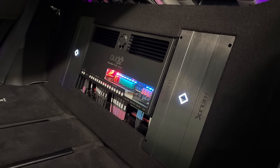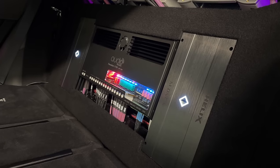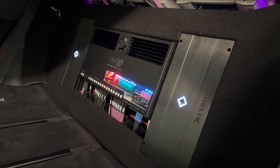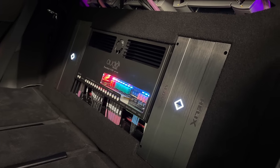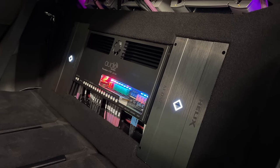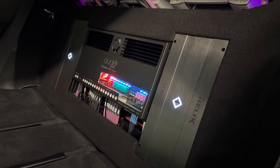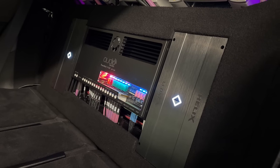And these amplifiers don't do anything wrong. They don't have turn on or off pop. They don't have any noise and they have plenty of headroom. So currently we are running one on each voice coil, giving us roughly, I think it's 700-something watts on 2 ohms, so on 1.5 probably you have around 850, 900 watts for each voice coil. Plenty of headroom.